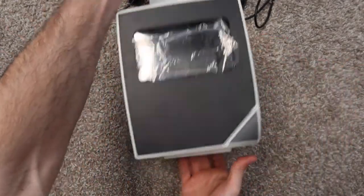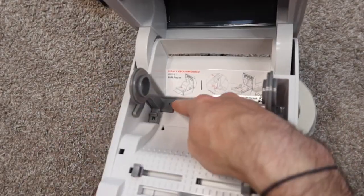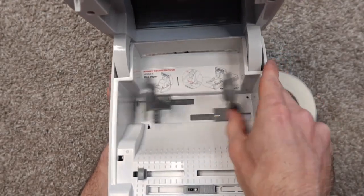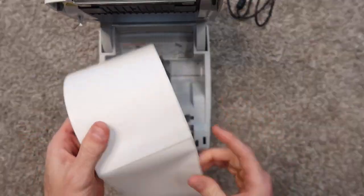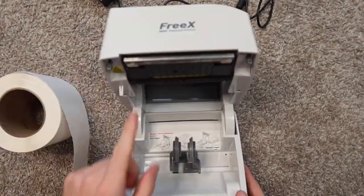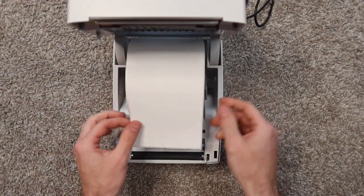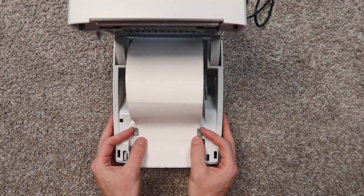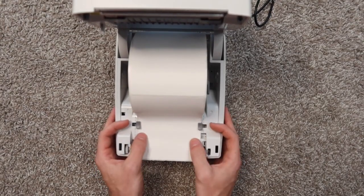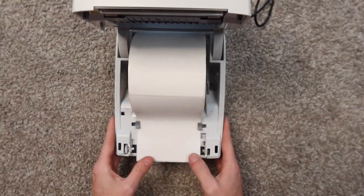I'm not a fan of that big contraption, so we're just going to install the labels directly into the printer. There's a little locking mechanism that you pull towards you, which activates the spring roll holder. Grab your roll and make sure the print side is facing up because that's what needs to make contact with the print head in order for it to print. Open it up, drop the labels in, and thread it through the label guides. You can adjust these — not too tight, not too loose, just enough to guide the label and keep everything in line as it prints.